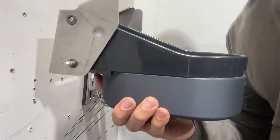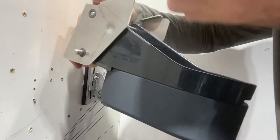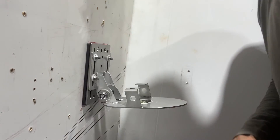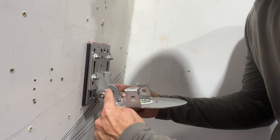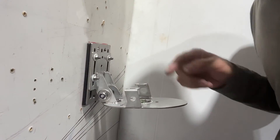The TM2 duty mount is rock solid — there's no vibration and no accidental kick-up. With the original mounts you get accidental kick-up; I've seen brand new ones just pull up so simply out of their locking mechanism at the back plastic, and obviously they rattle when they're in the water. This is rock solid — it won't be vibrating. These can also sit lower in the water because of the arms here, and can sit up to 50 millimeters deeper than the original mounts.